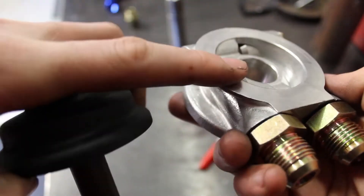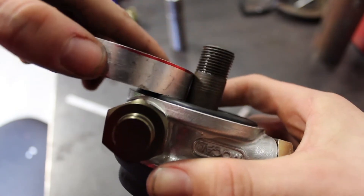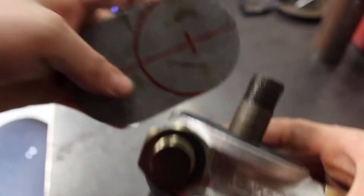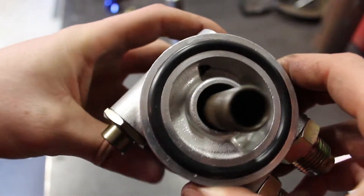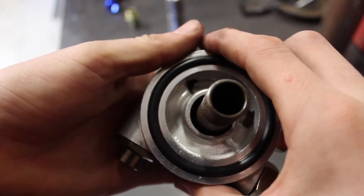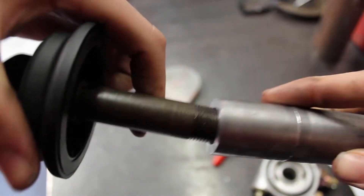Basically I need this surface to either be on the motor block or have it here, and this distance is obviously going to be an issue. So I found a piece of aluminum — it's about 16 millimeters thick, it should be basically perfect — and my dad's going to help me cut this on his mill. Also this is going to be an issue because if it's loose like this, oil's going to go in here, come out, and then just go right back through that hole and not get cooled. I think what I'm going to do is use this other piece of aluminum with a three-quarter inch hole — it's a perfect fit pretty much, so barely any oil would be able to go back through there.